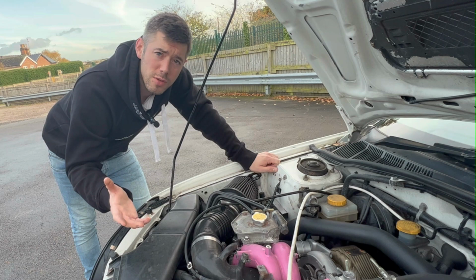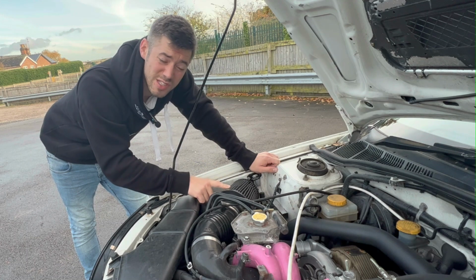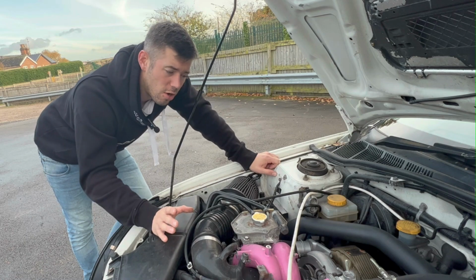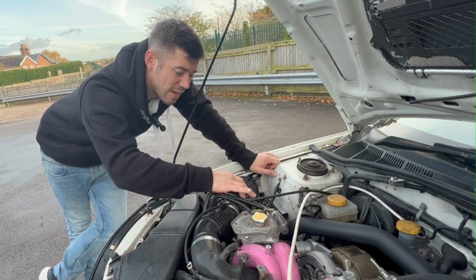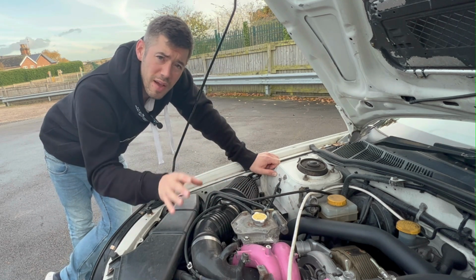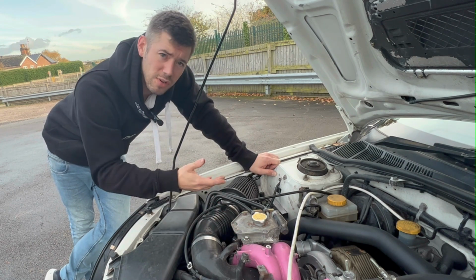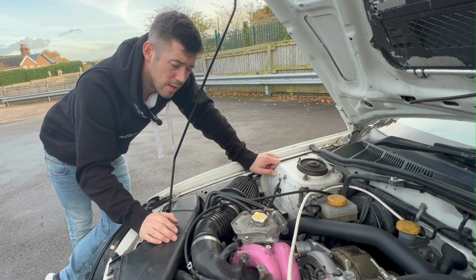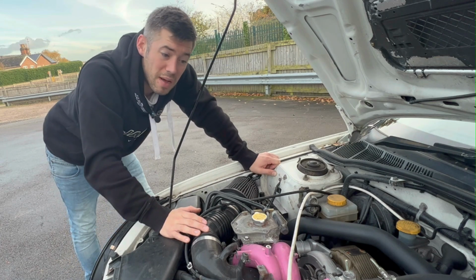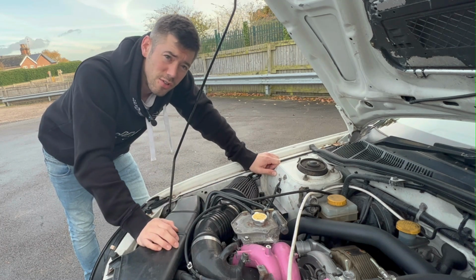If you're interested in like the Mighty Car Mods stuff or whatever, you'll notice that every test they've done, these filters, the cone filters especially, just lose power. I haven't got a choice with this. Also, cone filters on a twin turbo setup have the MAF here. So if you put a cone filter on, the air's not going through the MAF sensor the same way. So what happens is it can get an incorrect reading of the air that goes through, incorrect fueling, could lean out, could get rich, engine won't run as it's supposed to. Once you go to this kind of setup with a Link ECU like I've got, the car is MAFless and it goes on manifold pressure instead, then I'm safe to run one of these. Good bit is, they do sound really good.